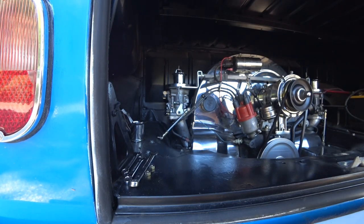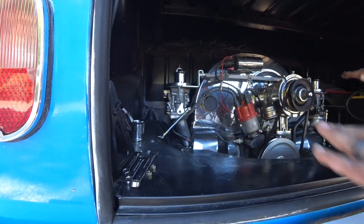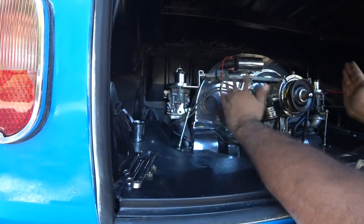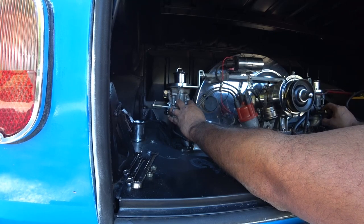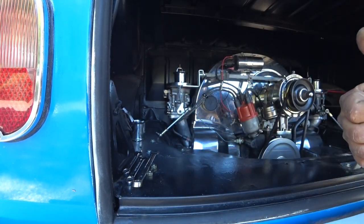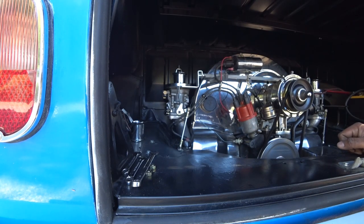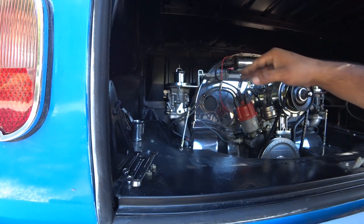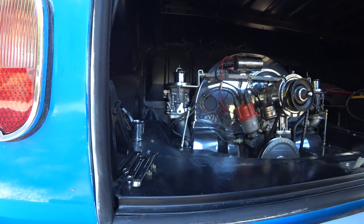Now you see the balance — there's no more vibration. We'll fix the mixture on that. Now that everything's idling correctly, when you give it gas it should be nice and even all around. There should be no vibration going back and forth — there should be an even throttle response, not a bouncy throttle response. That's how you know you're doing it right. Now we're putting it back together: put your links back on and go drive it. Pretty much everything is mixing correctly and idling the way I like it. Time to give it a little cleaning, dust it off, and go drive it around.